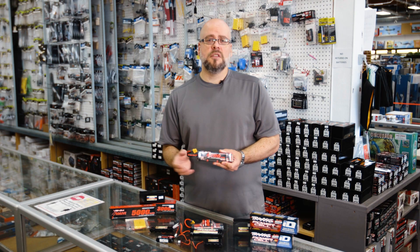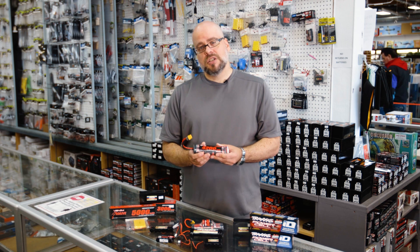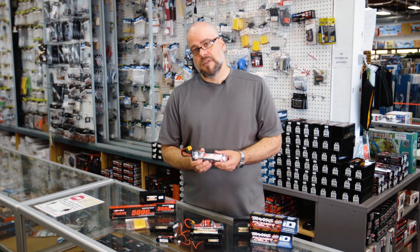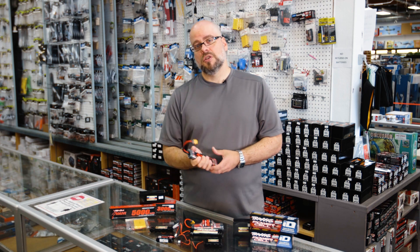Like a glove warmer you wear in wintertime — some people say armpit warm. Bottom line is, when it's on your charger you need to feel some heat. If you haven't used your battery for a period of time, say over the winter, the batteries do go dormant, so you need to charge them multiple times — 2, 3, 4, 8 times — until that battery gets warm. As a general rule when working with these batteries, just make sure that when the charger says it's finished, your battery does physically feel warm to the touch, and then you should be good to go.